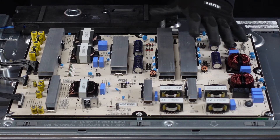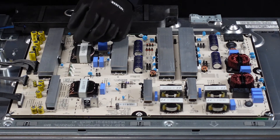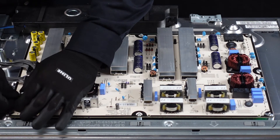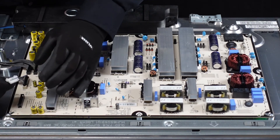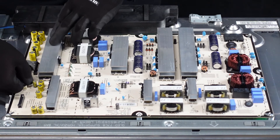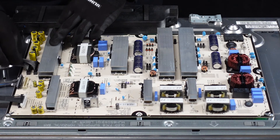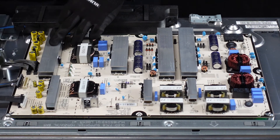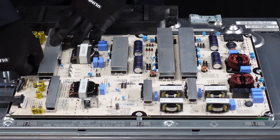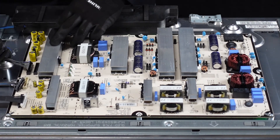Now we're going to be tackling the power supply board — pretty easy stuff here. These four clips we're going to get out of the board first. We're going to pinch down on the right and left side, which then releases the two clips, and we should just be able to pull that right up and away from the power supply board. This is going to be the one with the flap that we're going to depress with our thumb — same thing, comes right up and out. We're going to want to get the plug going over — get that out first. A little bit of tight quarters here but you should be able to manage. There is a small flap that we're going to push down with our thumb that releases the clip, and then that comes away.